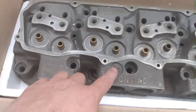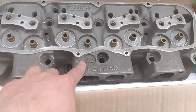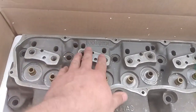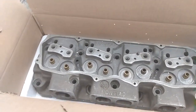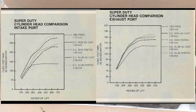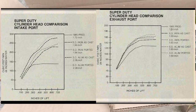And that is where this head was born — it came from their Super Duty line. This is a Super Duty 4, otherwise known as SD4, and like I said, it's Pontiac. This is the 801 head, and this thing apparently flowed like 265-plus CFM stock.